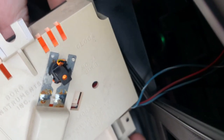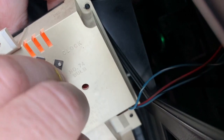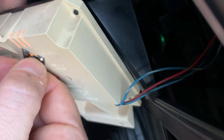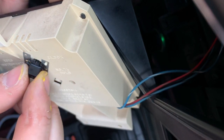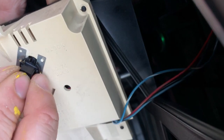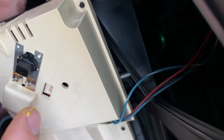Now the part that I found tricky — I apologize if it gets crooked. This bulb was not as intuitive as I would have liked, but maybe that's operator error. To remove this, you turn the assembly counterclockwise just a little bit, and then it pulls straight out. When those two gold pins are perpendicular to the sheet, you know that's the right position and it pulls straight out.